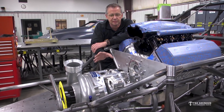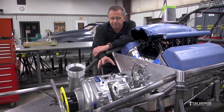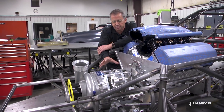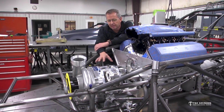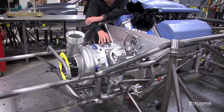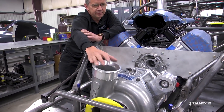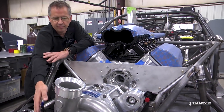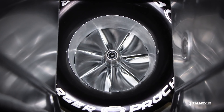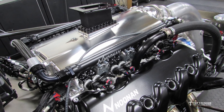So it's nothing new — this didn't just get invented in the last 18 months, but the way everybody talks, you'd think it had. ProCharger has been in business for a long time and they do a nice job on this stuff. This combination here is some of the latest technology that's out. Basically, we're going to rotate all this with the crankshaft and produce compressed air out of this outlet and into the manifold. We pull air in here, it gets spun by that impeller and pushed out into a charge tube, into the manifold — boost, fuel injected, big power.